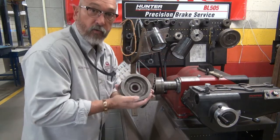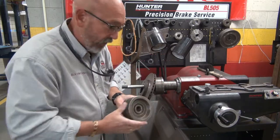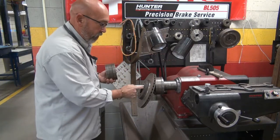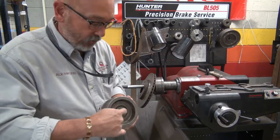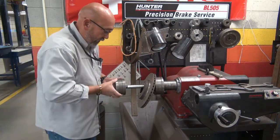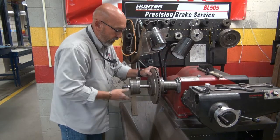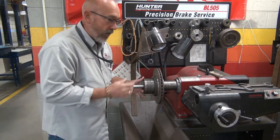Here's your outer cone — your outer bell. There's the groove, there's the pocket. It faces towards the rotor this time, because we need that centering cone to be able to stick inside this hole. So it'll go on there next. Set that up on top of your cone and push it in place. Give it a good push — he's in place.